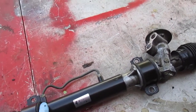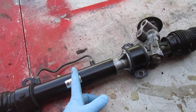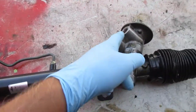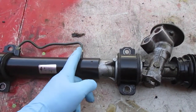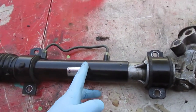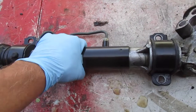Some people say that you need to tear all this apart to get the seal that rotates back and forth in here, but you really don't need to do that. The way power steering works is there's a seal in here and it pumps fluid in on one side which pushes it this way, then pumps it in on the other side which pushes it back. There's a seal right here in the middle and on the ends to keep the fluid pressurized and sealed up.